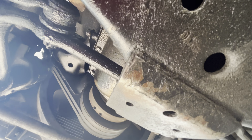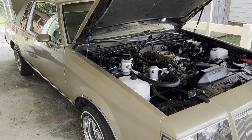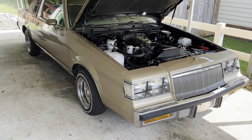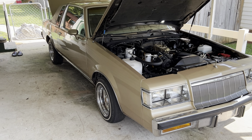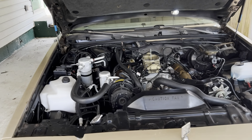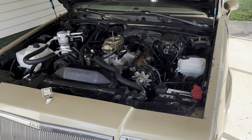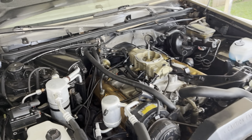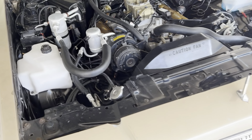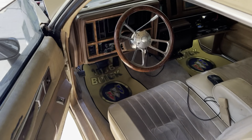I'm going to turn y'all back on when I get out from under here. We're back — I went up under there and a few of the bolts were loose, so I tightened them up. But nine times out of ten I'm going to have to replace that gasket. I'll need to get a hoist, lift the engine up, take the pan off, and replace it. That's probably going to be down the road. As long as I keep her under 75-80, she doesn't smoke. We'll do that later when we stack up some funds. Right now to finish off, I'm going to give y'all a cold start — on the last cold start I smelled a lot of gas when I shut the hood, so we're going to crank her up and look for fuel leaks together.